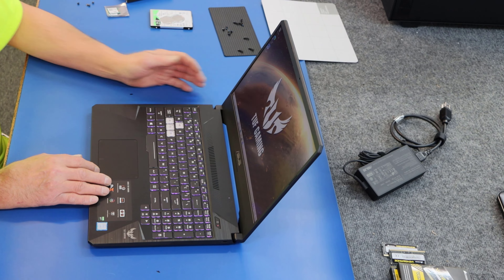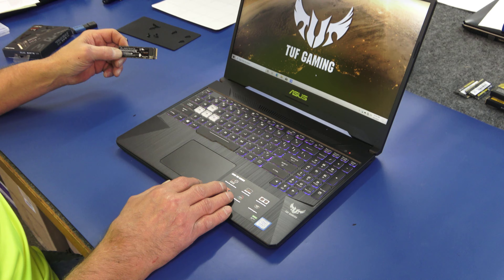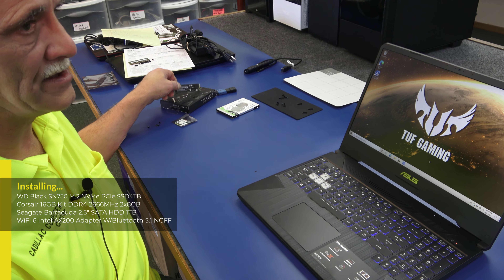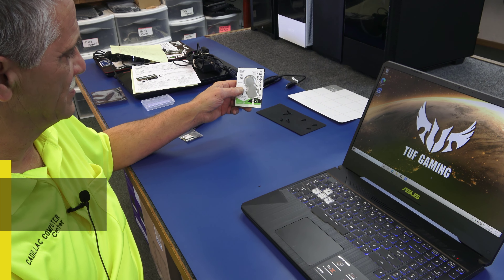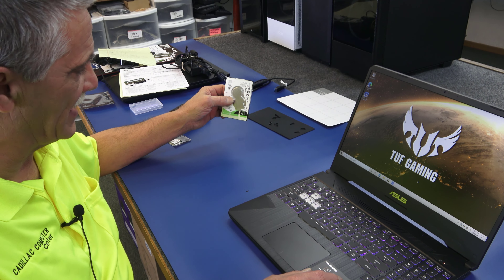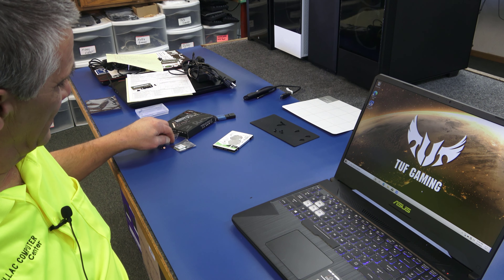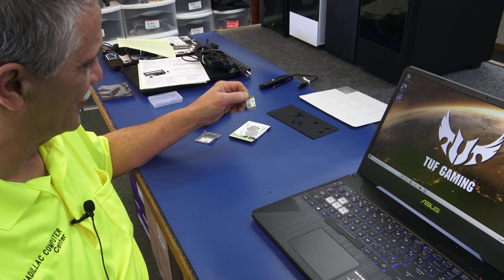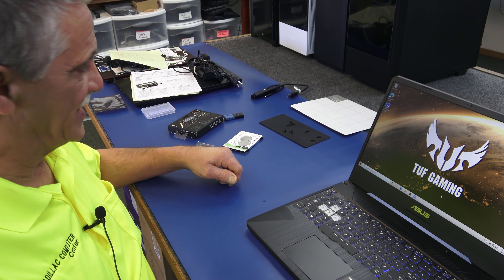I'm going to upgrade it. What I'm going to put in today is replace the 512 with a brand new Western Digital Black SN750 NVMe SSD. And I'm going to put in a 2.5 inch hard drive, 1TB. It does have a caddy pre-installed inside the laptop to accommodate this drive — they even included mounting screws for the caddy. I'm also going to upgrade the Wi-Fi card from Wi-Fi 5 AC to the new AX Wi-Fi 6 with an Intel Wi-Fi card, I believe it's the AX200.